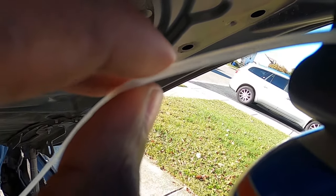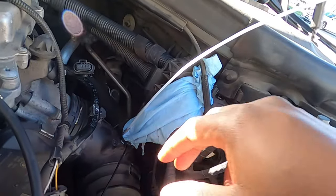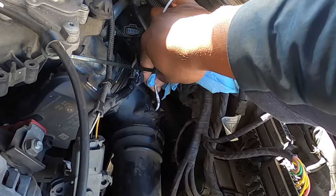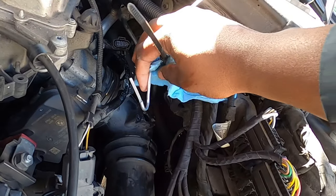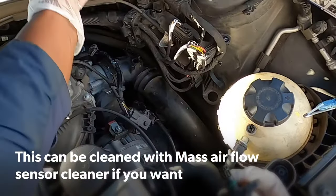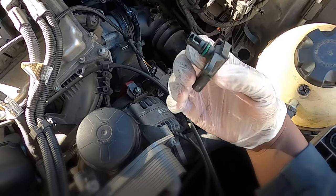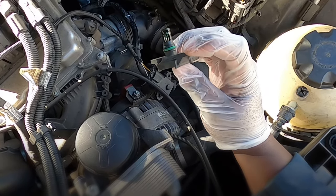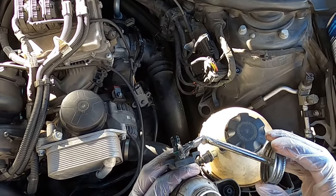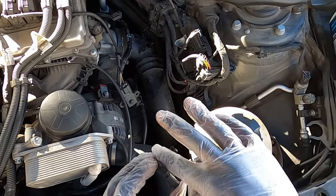As you can see there's still a little bit of fluid left, but it's kind of squirting so I'm going to turn it off now and close this — we're just going to take this out. Now let's get our sensor out. Truth be told, can you clean this? Yes you can. Am I going to clean it? No, I am not. Everything BMW is super sensitive — I'm scared to even try to clean this, so I'm not going to touch it. We're going to insert this back in and I'm going to get a little bit of silicone so that this goes in nice and smooth. Notice I'm not actually touching the sensor — just going to spread this a little bit and push this down.